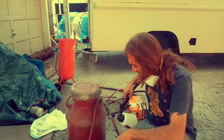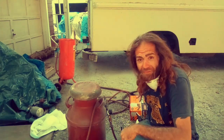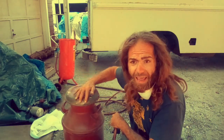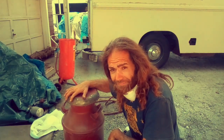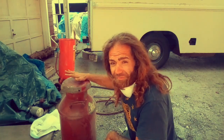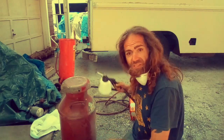And that's it, guys — it's used up. It was halfway full, now there's just a little on the bottom it can't reach. I have to tell you, just to do this one rim — not even all the way around, just this section — that was the whole container. It would take a whole bag just to clean one rim. Think about that. Unless you're using coal slag and you're in a tarped-off area with full ventilation and breather air systems, this is really not a do-it-yourself thing, guys.